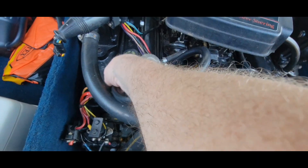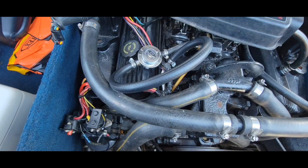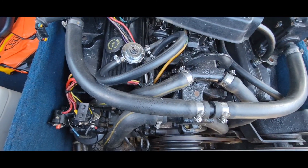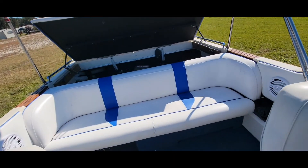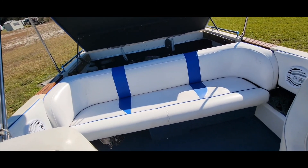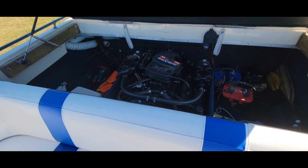With the old fittings from Desmond - thank you, Desmond - no more leaking. I'm just going to run this for right now. It ain't the prettiest, but I don't have a tubing cutter and I don't want to cut the metal line that goes down to the pump. The main thing is there's no leaks. I can tell a big difference in the way it's running now - it's a lot smoother. Before, when I would cut it off and come back and hit the key, I'd have to give it throttle. Now it starts with no throttle - just the key. A lot better.